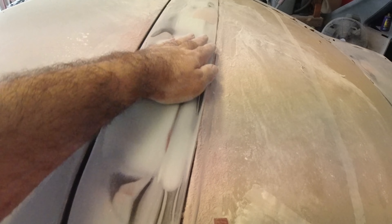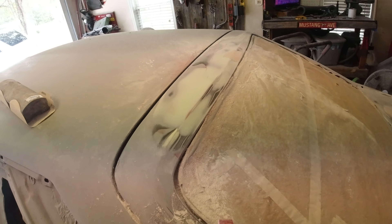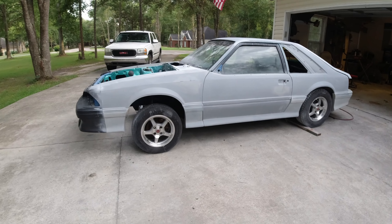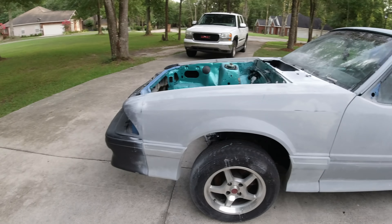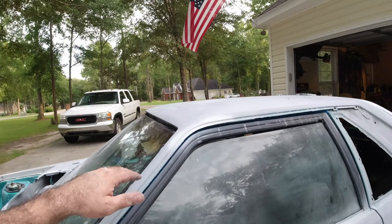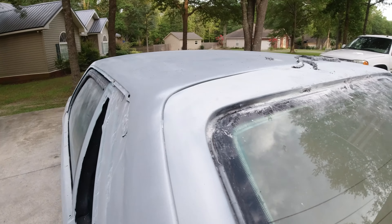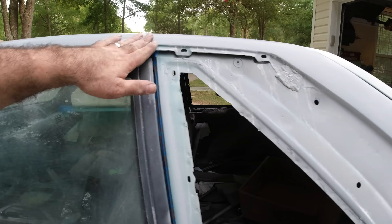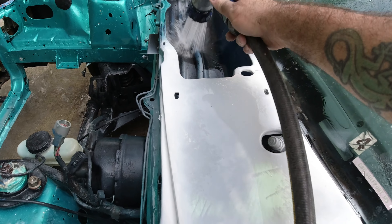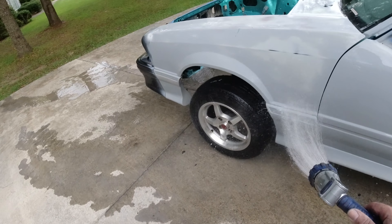It's looking pretty good. I got to go in and finish everything out now, but that is the gist of it. Hopefully you won't be able to tell there was a dent there when I'm done. It has been wet sanded with 600 grit for the most part. I still have to sand the front bumper and put some adhesion promoter on it, but other than that everything's pretty much done. The top really needs to be gone back over again — I'm picking out all these corners. We're going to go ahead and rinse this thing off as best as possible. Air works pretty good but air doesn't get it all, and I am going to hand wash the car here in just a few minutes.